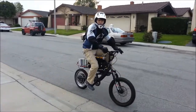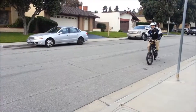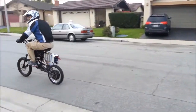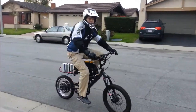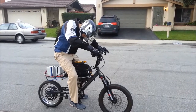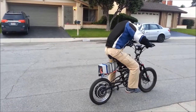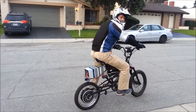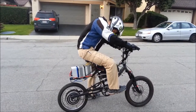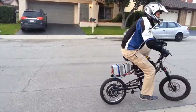To show the start-up torque, I'm going to throttle it while I'm on the front brake here. As you can see it has pretty good start-up torque — of course starting from a low speed will cause it to fault if you give it enough. Got it to fault. So at very low speed you can still cause it to fault by overriding it with the brakes. Then to get it to go again, all you have to do is pedal over the set RPM and it re-engages.